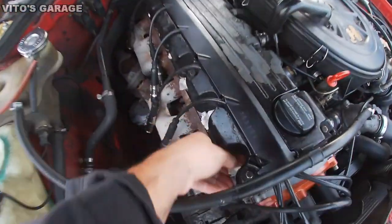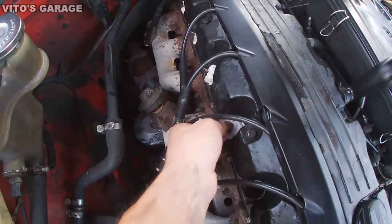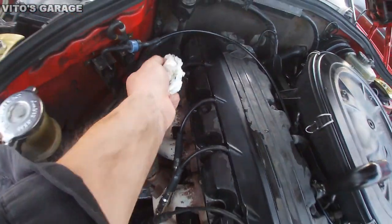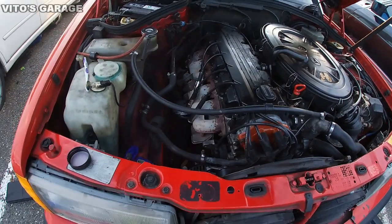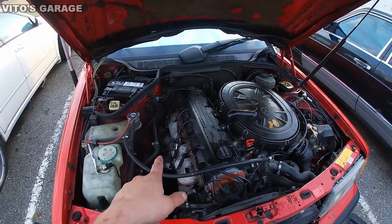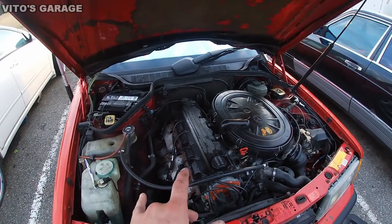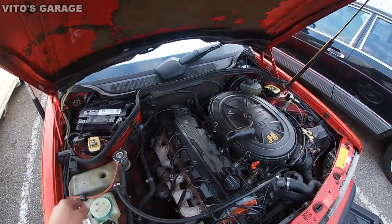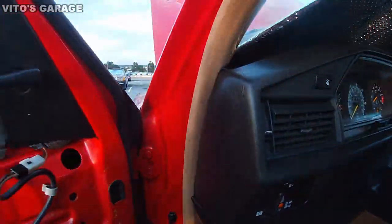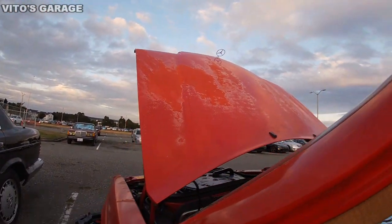Since we have fresh oil, I'm going to remove all these covers — the napkins over the spark plug holes — and take all those out, then crank the engine. The reason I want to crank the engine is to make sure all the diesel purge is cleared out of the cylinders, to prevent hydro lock. Fuel pump and everything is still out, so let's go ahead and crank it.